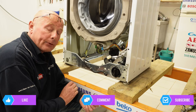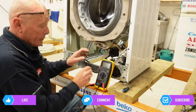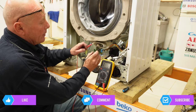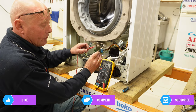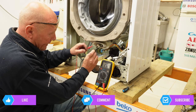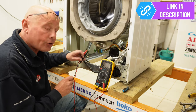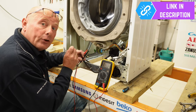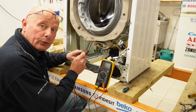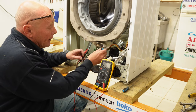I'm quickly going to show you how to test these. To test the heating element, take the two wires off, turn your meter to a low range — I've got it set at 200 — turn the meter on testing continuity. Across the meter we can see we've got an ohms resistance of 26.2 to 26.3. This is a 2000 watt element. Using the Ohm's Law calculator following the link in the description, you would be able to analyse the resistance value to verify the 2000 watt rating using the 26 ohms resistance.